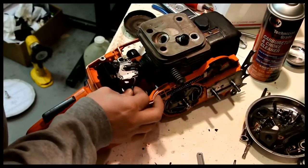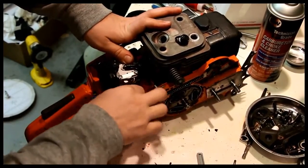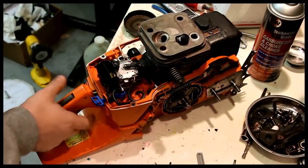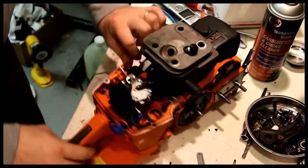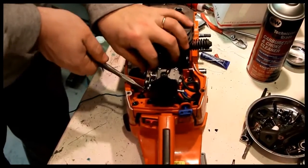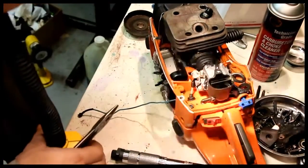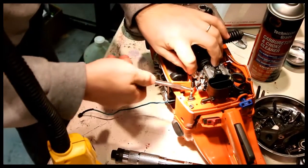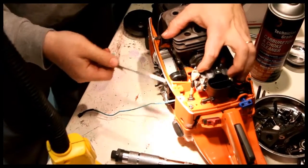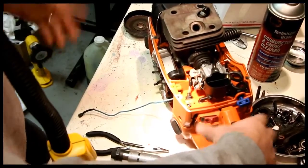So we're assuming the fuel line goes here. Let's bring the throttle linkage up to back this off a little bit, just so you can see it really well. The throttle line goes in. Pull. Bring the throttle line down. Linkage is in. Now you're good.